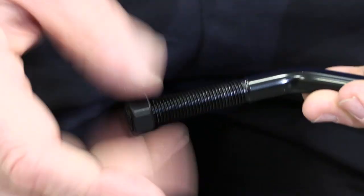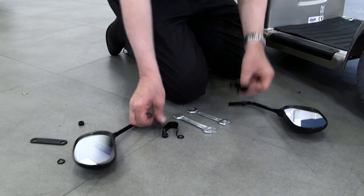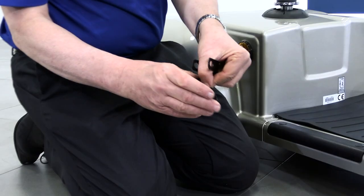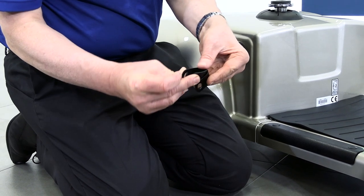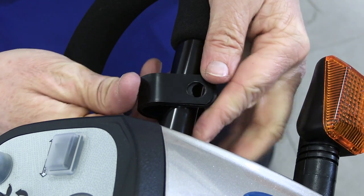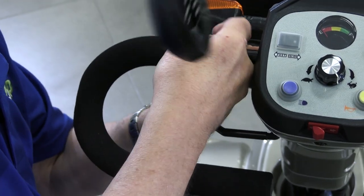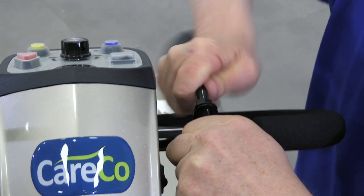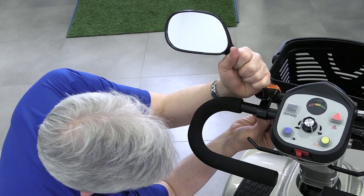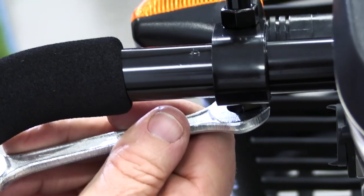Fix one of the nuts on the wing mirror until it is fully taut. Bend one of the plastic spacers to fit inside the metal U-bracket and ensure the holes on each component line up. The plastic layer of the bracket will prevent scratches to the paint on the handlebar. With the mount clipped onto the metal of the handlebar, feed the wing mirror through the holes, then screw the second nut onto the mirror and secure it in place using a spanner.